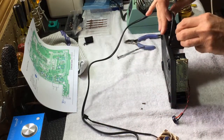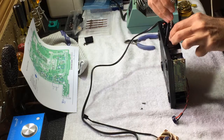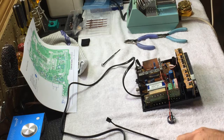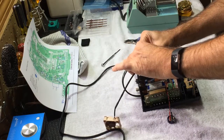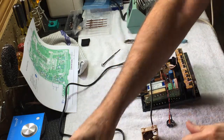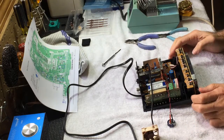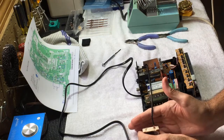I can also put the screws in the back. The larger screw holds in the FM antenna connector, and the two smaller screws go on the other side. Moment of truth — let's plug in our fan right there. Make sure nobody's shorting out against anything, and let's power up. The clock is blinking — that's good. Turn the power on. Fan is spinning — that's extra good. We have airflow.